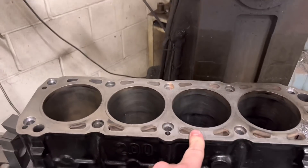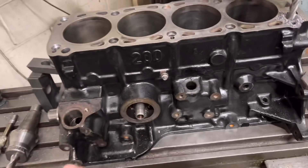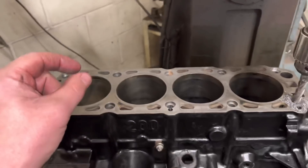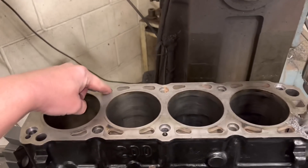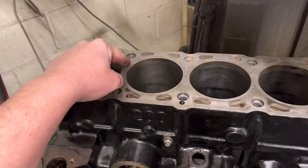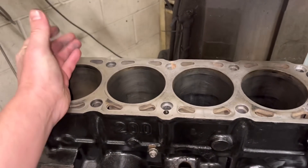It's already got the six studs, but the trouble is with the studs that were added — they were the short type with the built-in, or machined-in, 17mm O-ring washer in the middle of the stud. That washer goes down into this 17mm groove here with an O-ring on it, and that's what does the sealing. The only trouble is they can only go as deep as that washer will go because it's machined into the stud.